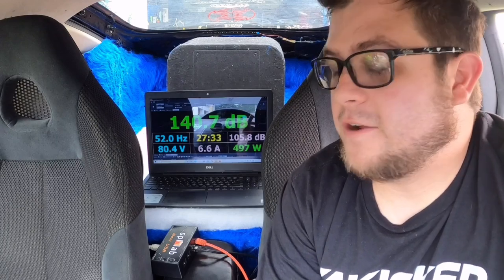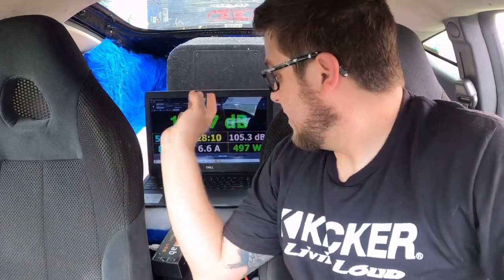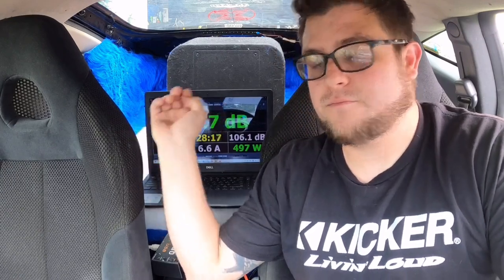Right there is a prime example of why, with this type of enclosure, sub firing to the rear with the port firing the same way as the driver is louder. Every vehicle is different — type of ceiling, type of scores, frequencies you're targeting all vary. But with this enclosure in this vehicle or an SUV, we literally doubled our output — same amount of power, same driver, just by switching the enclosure to fire to the rear.